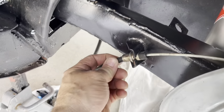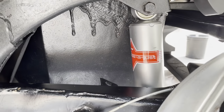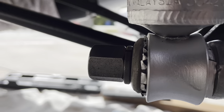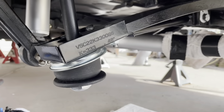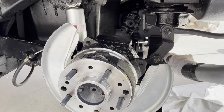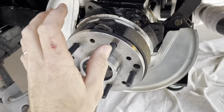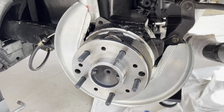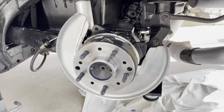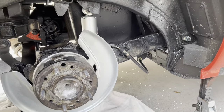The torque spec on this one is 70 to 80 foot-pounds, then a cotter pin. That's pretty much one side done. I still have to finalize the parking brake and brake lines, and the brakes aren't on yet, but the shock is in — I went with a typical KYB gas adjust shock, 30 to 40 foot-pounds on that. The sway bar is preliminarily hooked up and needs to be finished when the car's back on the ground. I want to get the other side hooked up and the half shafts connected before doing too much else.